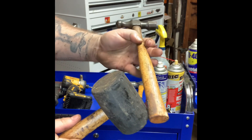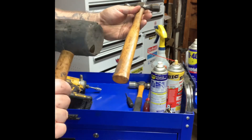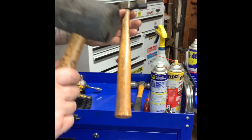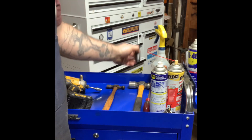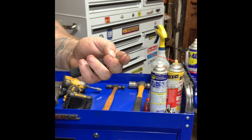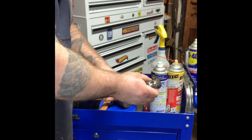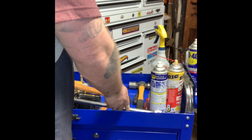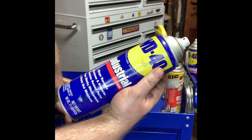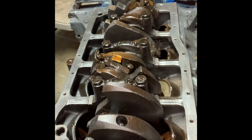We're probably gonna use the rubber mallet, but you're gonna want to find a thin piece of wood like this because it needs to go down between the pistons and you tap it out. You want wood or rubber — don't do steel. Also you're gonna want a screwdriver you don't really care about — a Harbor Freight flathead. And you're gonna need some sort of breaker bar to turn the engine so you can do the pistons. You might need a little lubrication when things get slippery.